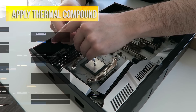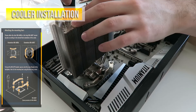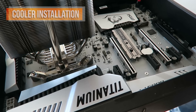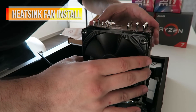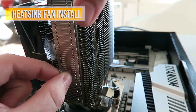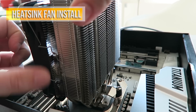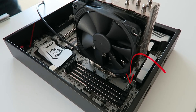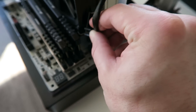The cooler came out of the box easy to install — just line it up with the holes and tighten the screws down on each side. You can then attach the included fan, which is typically beige and light brown in Noctua fashion. This one's a black variant. By using the provided thin clips, just latch them around the edges of the fan and move them forward to grasp within the fins of the cooler. Then grab the CPU fan cable and plug it into the CPU fan connector labeled on the motherboard towards the top.